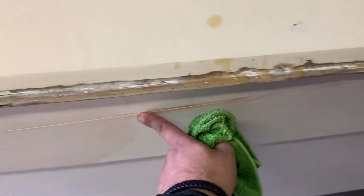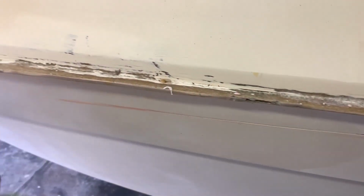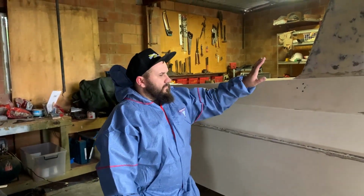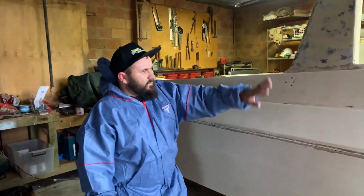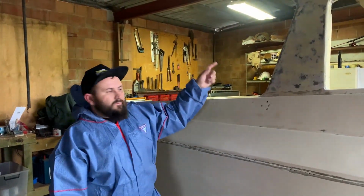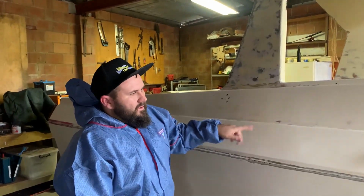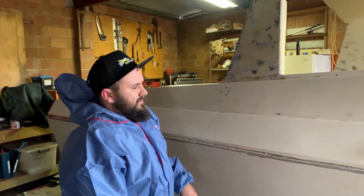And then, when I got the boat in, bit of a scratch here. There's a brick wall. It was pretty tight, so I'll fix that up. So I've just waxed and grease removed pretty much the whole outside. I'm not gonna do the inside first. I'm gonna put on the first coat of primer now. The first coat of primer will show me all the little imperfections.